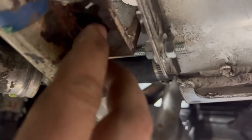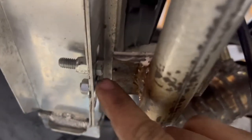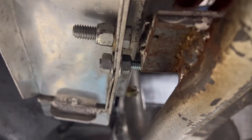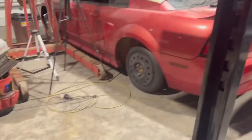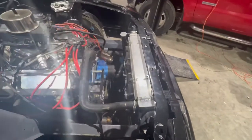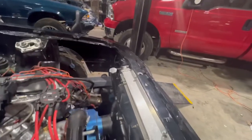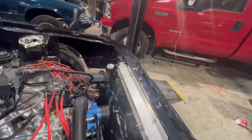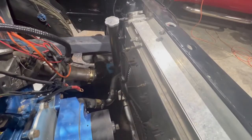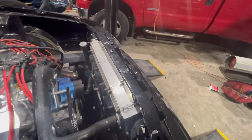There it is. I put a nut on one side so I could jack it out, and a nut on the other to tighten it down, and I got daylight there on both sides — just barely, you can see there's a little space. So the radiator is mounted. On the other side I got the hoses in. I was able to get the overflow in but I had to move it back — I had the bottom mounted out a little more — but there's plenty of room there now. That's done.